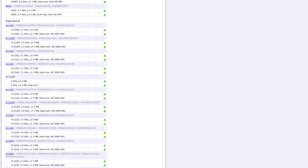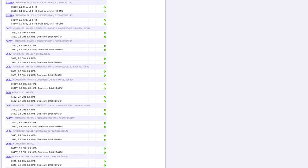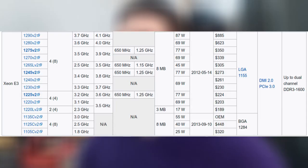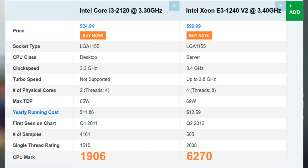Looking at a CPU upgrade website you can see many CPU options but not the Xeons. Looking at the wiki for the Ivy Bridge processors in the Xeon E3 section, you'll see a number of options for LGA1155 processors, and you'll also see that all Ivy Bridge processors with one, two or four cores report the same CPU ID. A lot of people report that you can use same CPU ID processors interchangeably. Other things to look out for are power usage and thermals.